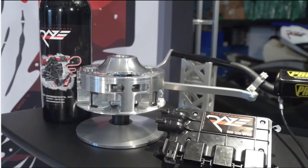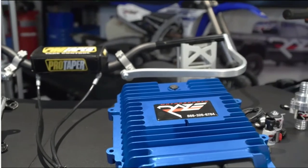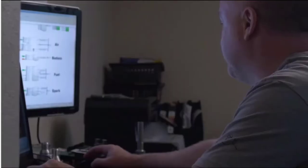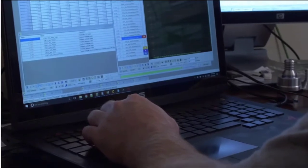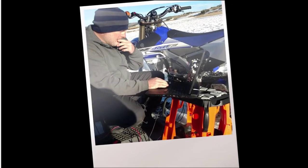So for this assignment, we laid out a new hardware platform that includes a barometric pressure sensor on the board, inputs for an O2 sensor, a large amount of RAM to run 1kHz closed-loop tuning, and a knock sensor input for feed-forward knock control. We then paired the bootloader to our firmware, wrote a snow bike engine strategy in MATLAB, implemented it into our calibration toolchain, and spent a couple hundred hours in the mountains calibrating the engine so our customers would never have to worry about the tune.